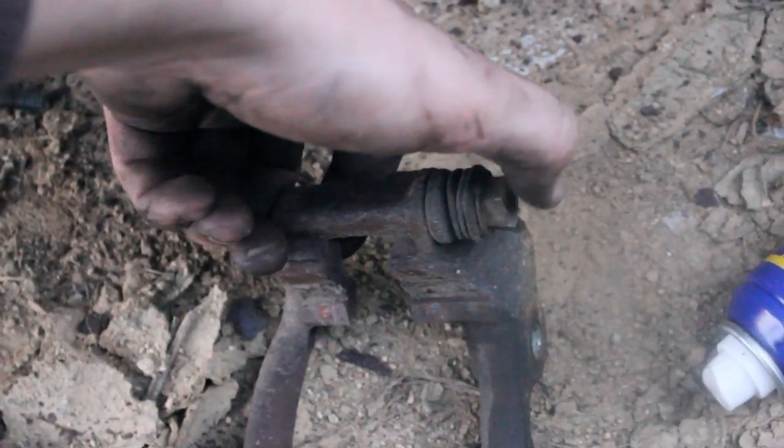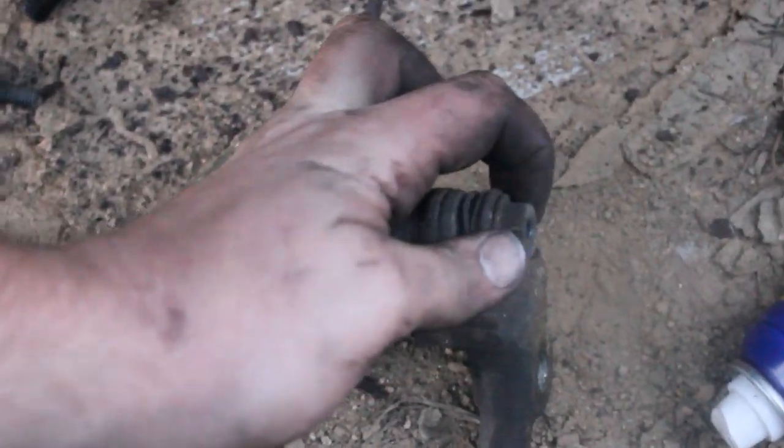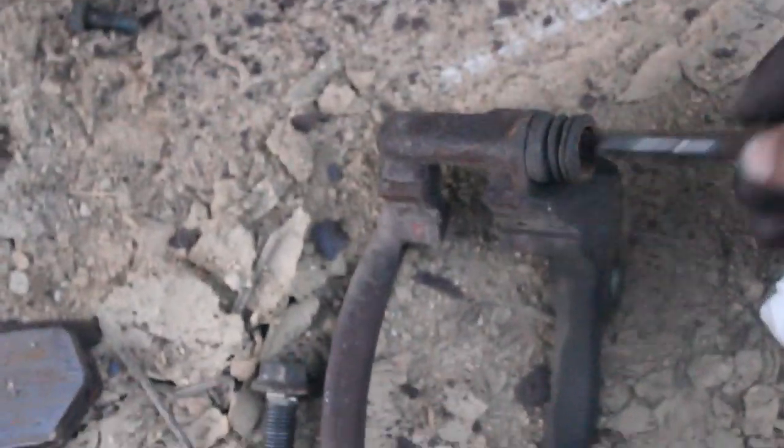Alright guys, that's your caliper bracket right there. And what we're looking at right here, see how I'm pushing that in? And it slides back and forth like that. If it does not do that, if it's stuck in there, you are going to need to remove these pins and lube them with grease. Preferably high temp brake grease, and you can just take them out like that and wipe them off clean